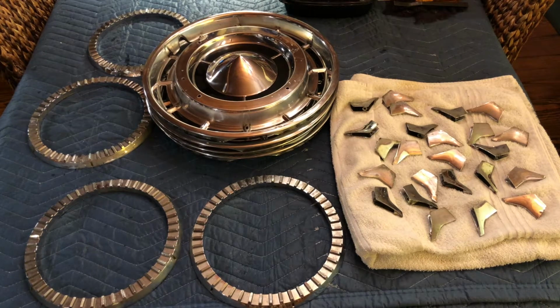Okay, following the wash, we're now going to let the parts dry out thoroughly. A technique that I use to speed up drying is I rinse the parts in the hottest water that I can stand for my hands as possible. That heats up the metal and helps drive out the moisture as the parts are drying.